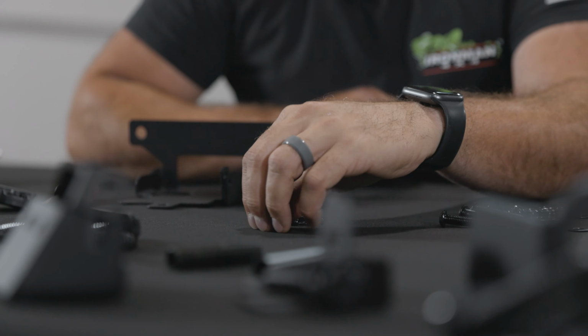So I'm gonna use a number 5 Allen key here, and because the nut is flanged and serrated, as long as you've kind of got it a little bit tight, it's gonna bite down on its own. So I'm just gonna get it snug for now, because again, you're also trapping plastic and aluminum, and we haven't put the hardware in on this side yet. And another reason why it's good to tighten up this hardware and leave this one loose is because we can slide the bracket out. We can take our wire harness, our connector, snap it into place.